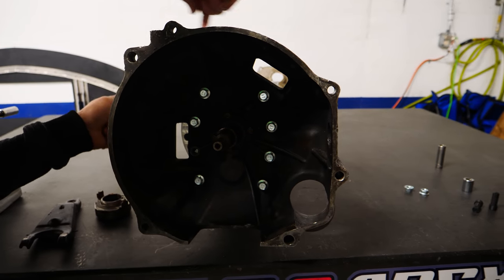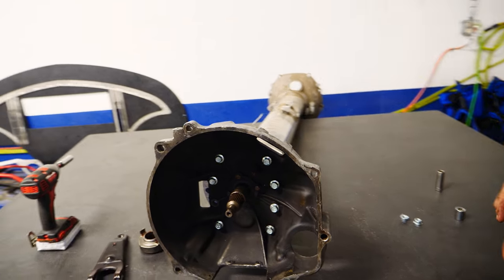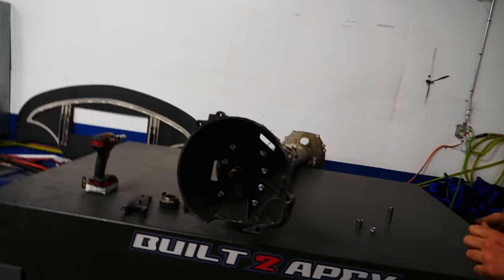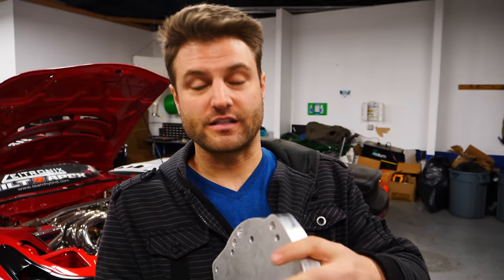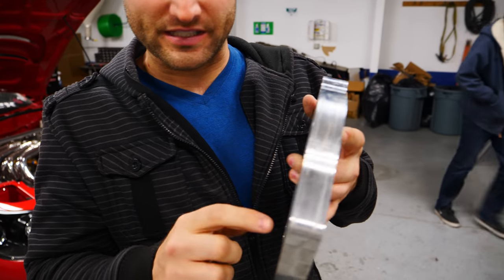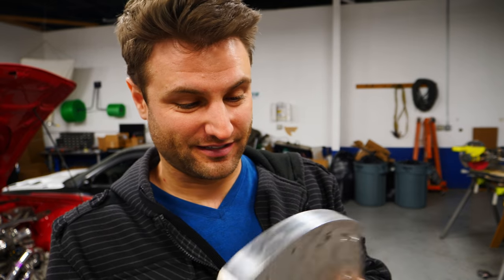We've got the maximum number of bolts you can have on this — seven on this side, five on this side with the dowels, so essentially seven on both sides since the dowels count as support. That's literally ready to put a 13B into the Corvette. This was the prototype piece — literally the first cut — and everything bolted up perfectly. If you know me, I forget half the bolts, yet this literally has the most number of bolts on both sides working beautifully. So there you have it: a 13B — or really any rotary — adapted to the Turbo 2 bell housing and torque tube for a Corvette. Built to Apex made a perfectionist piece — the outer edge refinement isn't necessary for function, but he's a man who likes things to look good, and look good it will.